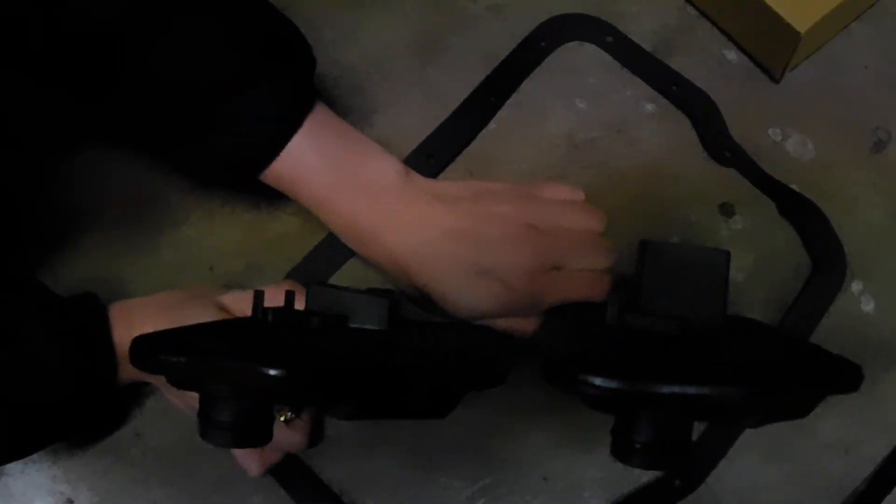It's going to cause you all sorts of shifting problems. So if you've got an 08 and the trans is acting up, you might have the wrong filter in it. When you order a filter, order for an 09 or a 10 with the 5-speed.